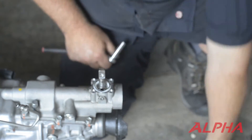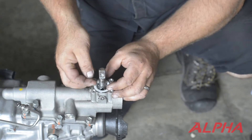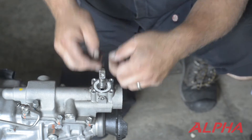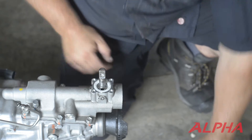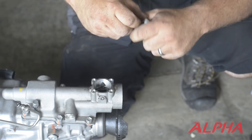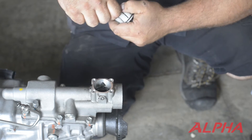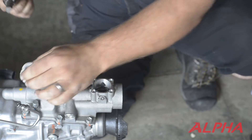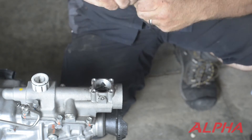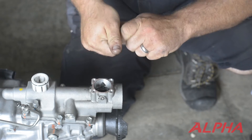You're going to keep this plate and set it to the side. There's a spring clip here — you're going to pull it off, set it to the side, and then lift out your shifter. Then you're going to pop this piece off, reuse that, and pop this end off here and reuse that as well. It does take a little bit of force to get this one off.